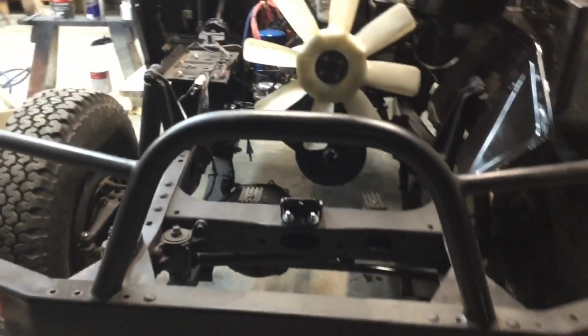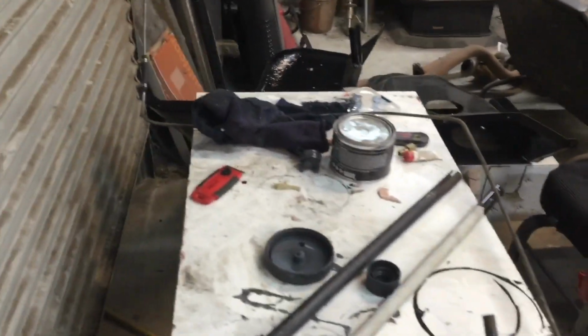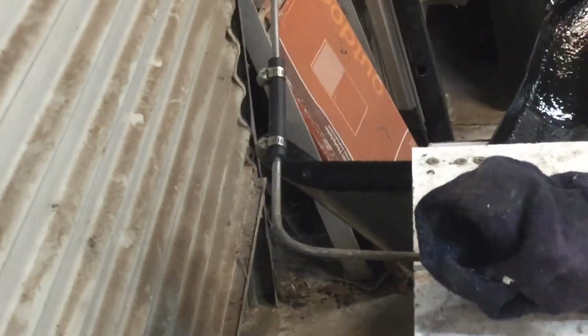And yeah, I got the fuel line over here, as you can see, up over here. That's where it split and it kinked. So my mechanic suggested that we just replace it with a bit of fuel line. So we just chucked a couple of hose clamps on there. I'm probably going to put a couple more just so it doesn't blow apart, because I think it could be the suction line, but it probably is just a return line from the carby back to the fuel tank.